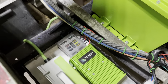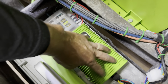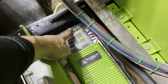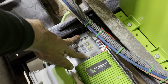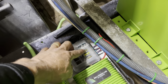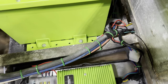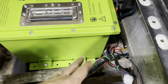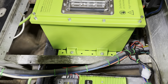For our 12 volt supply, I ran the red from the 12 volt reducer wiring harness to the positive post on our fuse block and grounded the negative post — you can ground it at the battery terminal or at the B negative on the controller. Now we're getting 12 volts in, and I have all my 12 volt items here, which is mostly lights and turn signals. Using the Bolt-supplied zip ties, I did some wire management. There's really not a great place in these DS's or Carry Alls to hide all your wires — just make sure none of the wires are hanging below the frame, because I've seen them get pulled out.